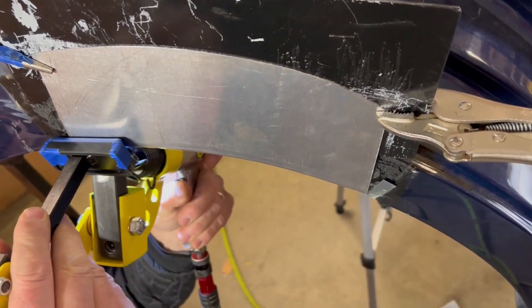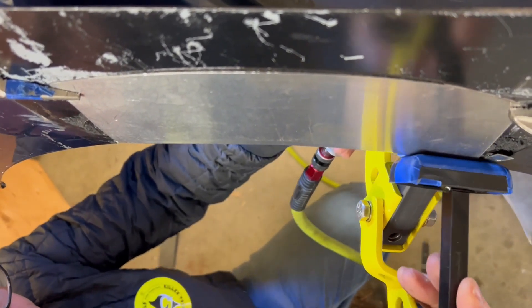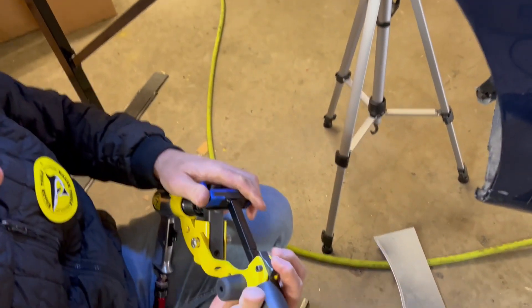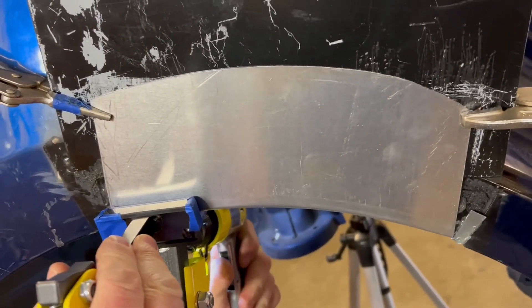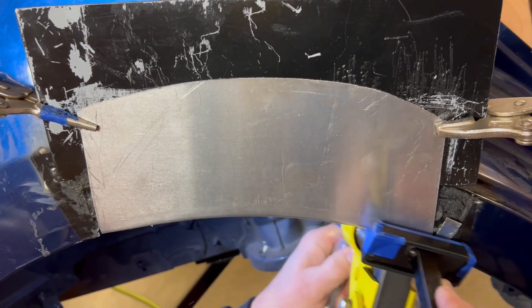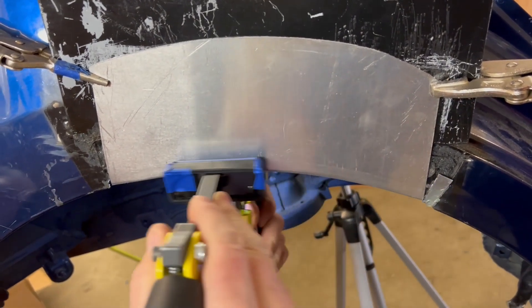Step 1: Use the long shaft. The rubber dolly should be held firmly flat against the outer skin with the guide pins at 90 degrees, or perpendicular to the skin. The hammer should be touching the door flange edge. Use the appropriate notch on the shaft to create the proper angle. Begin by making 6 to 8 passes along the edge until the flange is folded over 45 to 60 degrees, remembering to always keep the tool moving.